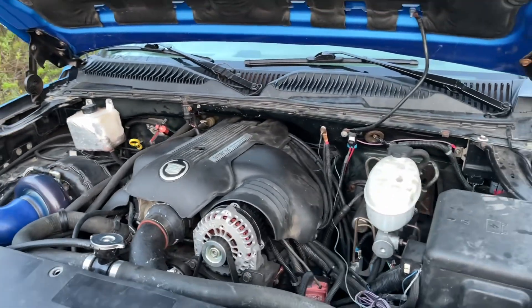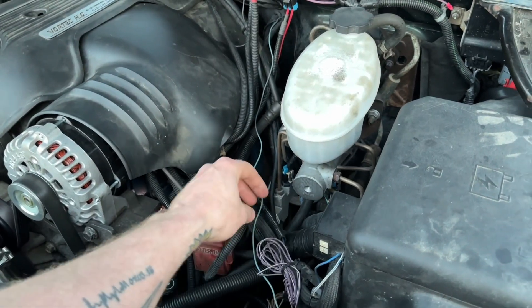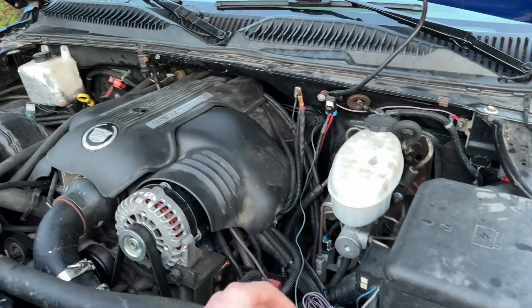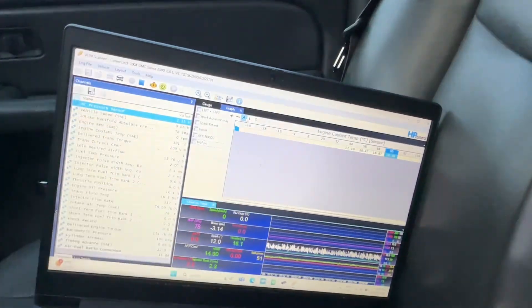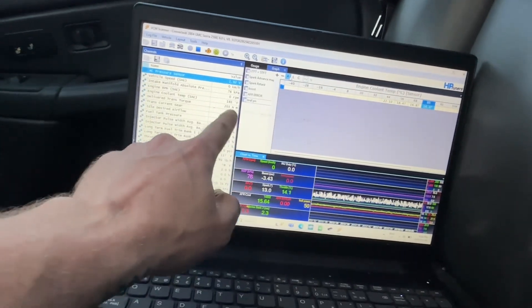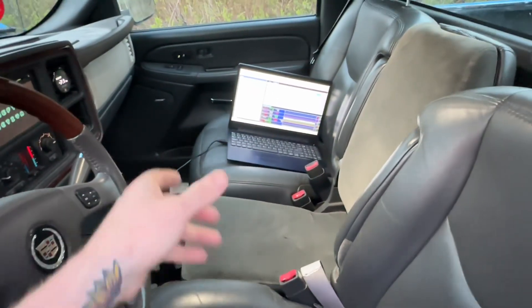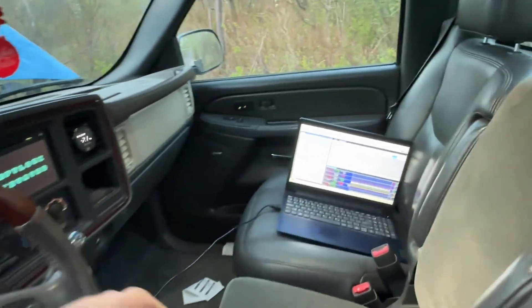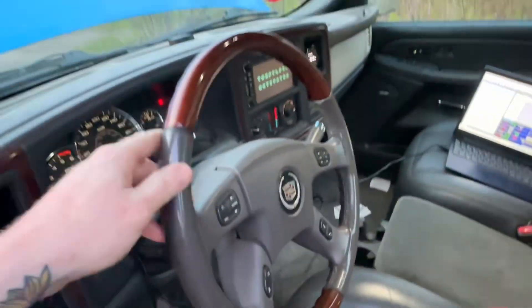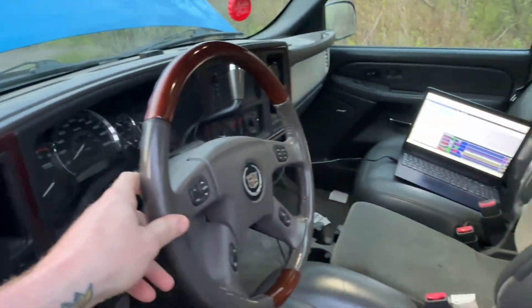The engine is looking really good. I've got to tidy up a little bit of wiring here — this was just a wire I put in for the wide band, and for the other wide band. Actually, I have two in this truck, plus the boost sensor. We're getting really close now — I would say the engine is probably up to operating temperature. We're in the 80 cell and engine coolant is at 181 Fahrenheit. I've got a 160 thermostat in this and the fans are set to cut in at 185 and maintain around 180. With the temperature outside being 16 degrees Celsius, I don't think it's going to climb any higher. Going to go ahead and hit stop on this log, pop it up in neutral, and shut it off.